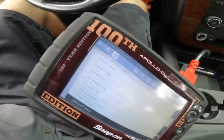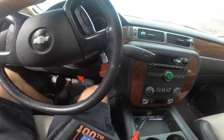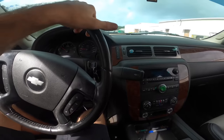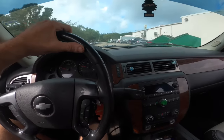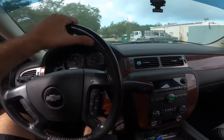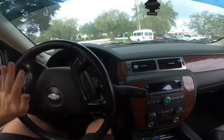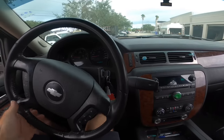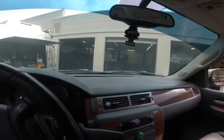Ordinarily I would want to go after an electrical issue, seeing as how it's saying it does not have ignition one voltage. But the problem I have is I'm getting a lot of rattly noise out of this transmission. So I'm going to get into the shop when that oil truck moves and check the condition of the fluid first, because this thing may have a grenaded transmission or at least a grenaded torque converter, with torque converter components all over the place through the system. It may have to come down and be pulled apart.